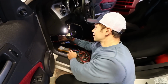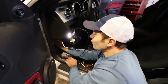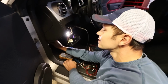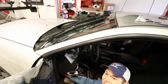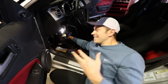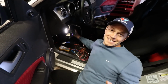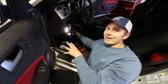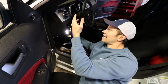And remember that wire I told you that you can tap into for a switched 12 volt source? Well, watch the wipers here. Oh. Yes, what it does is it somehow triggers the wipers. That's so random. It is. I don't know how, I don't know why, but it does. Okay. So it just goes to show with the new cars and the modern wiring, you just can't pick a switched 12 volt and tap into it because random stuff like that's gonna happen.